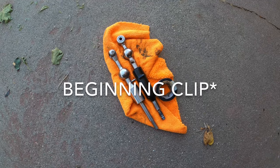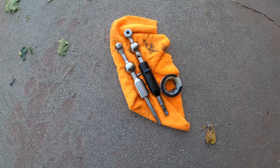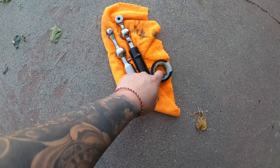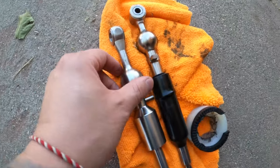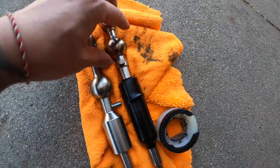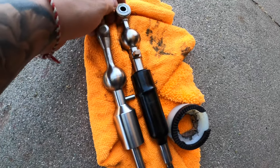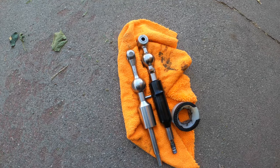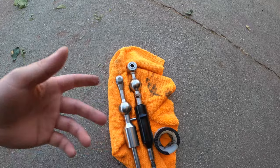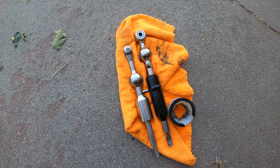This was not easy and not fun — I should have done this properly. After you get this off, take the extra grease and grease around the pivot point and the end link. If you don't have extra grease, I would suggest buying some lithium grease before you do this project. So: buy new coupling, buy lithium grease. Let's get this installed — I'm tired, stressed, and pissed off.